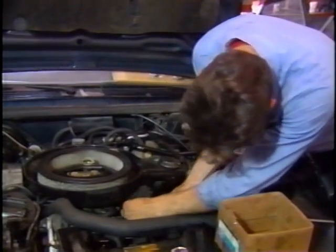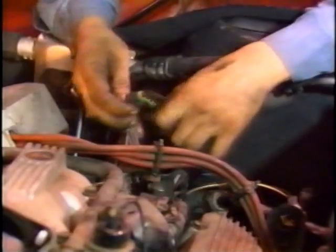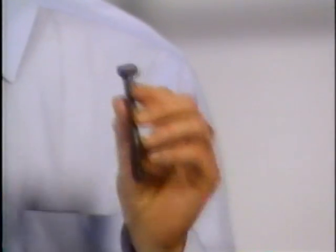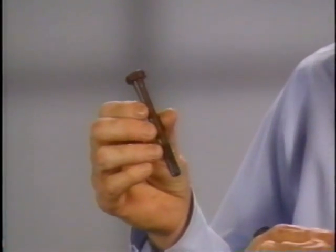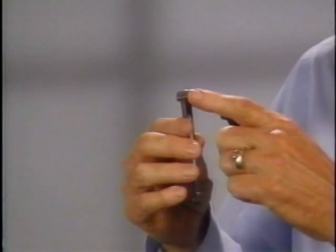Consider what might happen in a real-life situation where bolts may not be in perfect condition. The fastener lab at General Motors did some tests to find out. They took two identical bolts — one in ideal condition, with perfect threads, properly oiled, and carefully broken in. The other was dirty, with nicks on the threads, the head rounded, and so on. All factors that reduce clamp load.